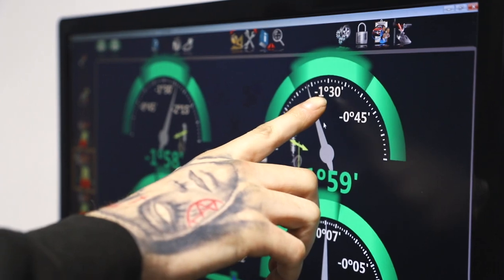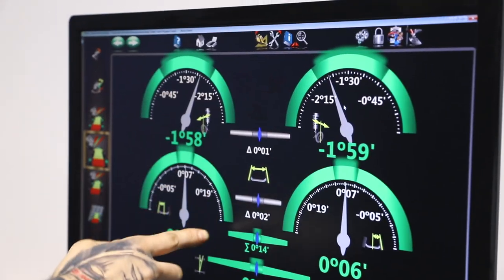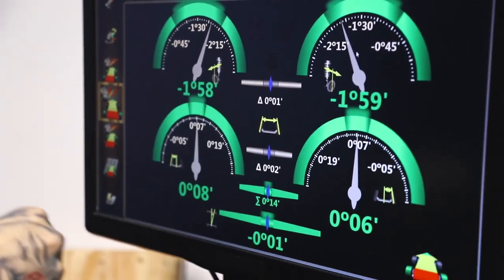So we've got the car on the system, it's all set up. I just wanted to show you the alignment specs. This is the rear of the car — the top two show camber at just about two degrees, which is too much, so I've got to remove some of that because it's going to induce tire wear. It's only a road car, not a track car, so it doesn't need that much camber. Stock is 1.3 degrees, but we'll go in with a fast road setup to my specifications. The toe is pretty much bang on, but because I'm going to change the camber that's going to move as well, so I'll need to fix that after — and then it's on to the front.